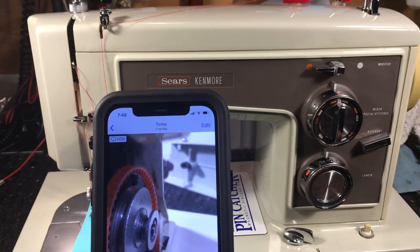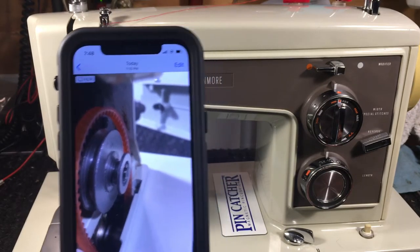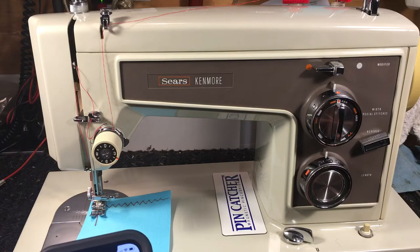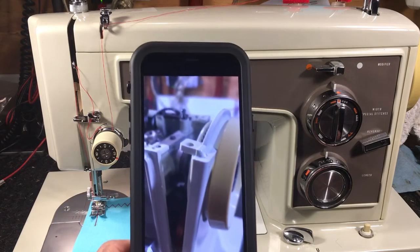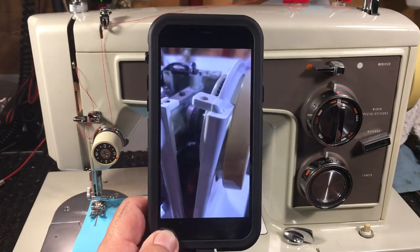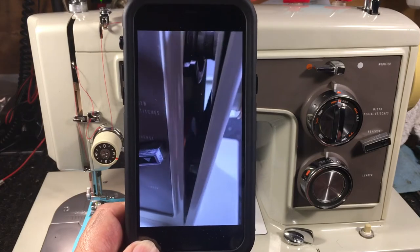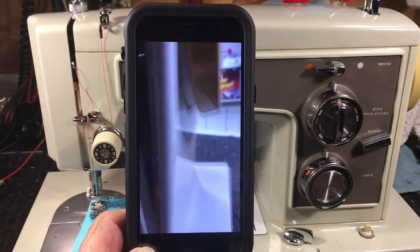Get the bottom belt put on — this belt is a 1100, which means 11 inch, so when you order a belt for the bottom, that's the size. The other one had a couple of little issues, a little ding, and it had just sat for a while. Oil will sit on it and cause it to deteriorate. We got that taken care of. Getting that belt back on can be fun, and what you do is make sure the belt is loosened as far as it'll go.